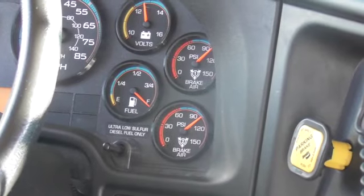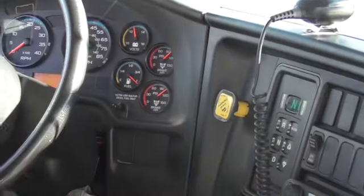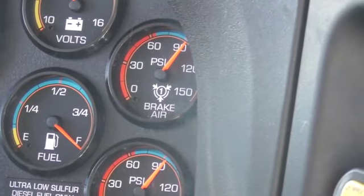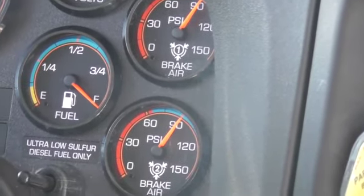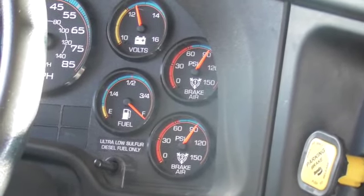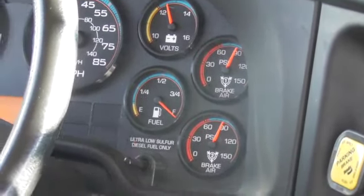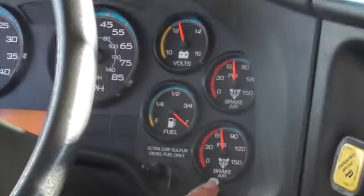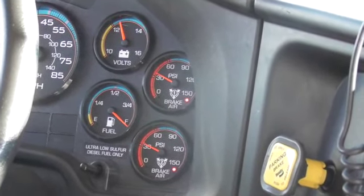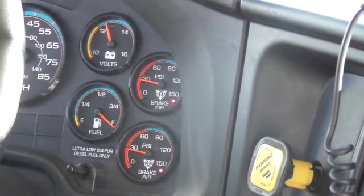I would put my foot firmly on the service brake watching the gauges to lose not more than three PSI pounds of pressure in one full minute. For the purpose of today's filming we will say 60 seconds have passed. They're holding securely. Now I will begin to fan those brakes, and at approximately 60 pounds of pressure I will get both a visual and an audible alarm. And between 40 and 20 pounds the brake applies itself, which would stop the bus and not allow any danger to come to my students.